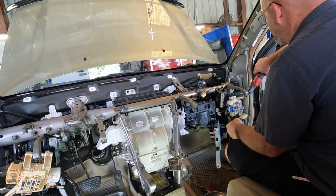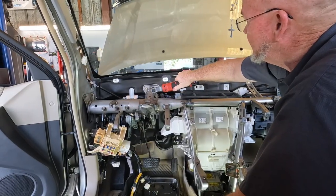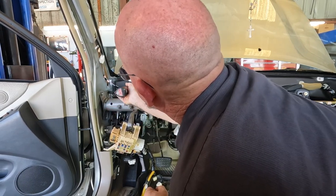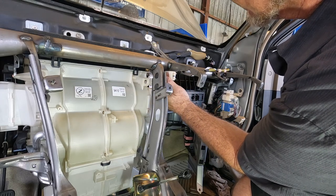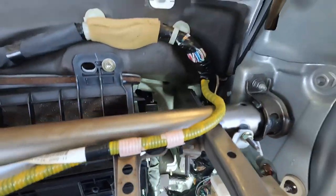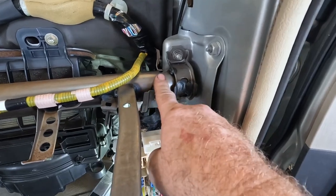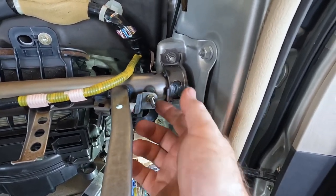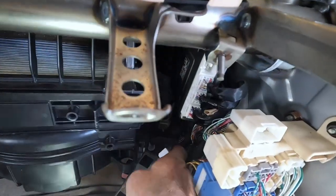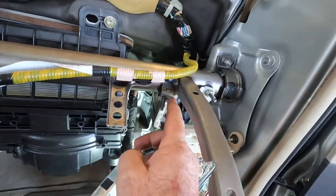I think the silver-colored nuts go on the ends — there's a difference in their strength or something structural, so I'm going to swap out the gold ones for the silver ones. There's a bolt down there and a bolt up here for the BCM. Since it's on a long welded stud you gotta take both bolts out to pull it away. The PCM is trapped on the same bracket, and the top of the PCM goes to this stud.